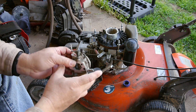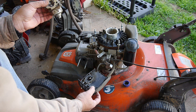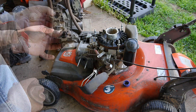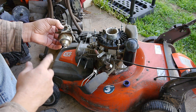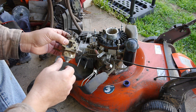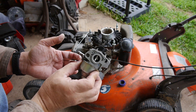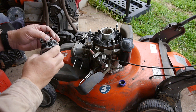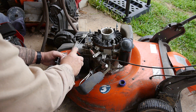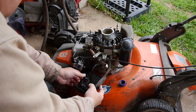The gaskets look okay. This one needs to be cleaned on this side, but the gaskets look good — they're not cracked, so it's just dirty. I'll take this apart and do the usual cleaning. If you'd like to see this in detail, I have another video out there on how to clean a carburetor — look for it on my site. I can include a link to one on cleaning carburetors. So there's the clean carburetor. Did the usual stuff, put it all back together. Let's remount this.